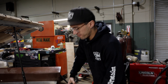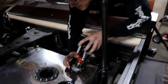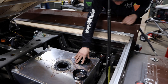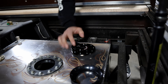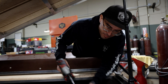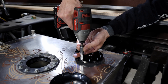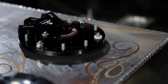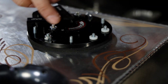Now this is ready to be installed in the tank. The first step is installing our gasket over the studs and then very carefully installing the sender into the tank itself. Line up all the holes, get it sitting flush. To fasten this down in the tank, you go ahead and take these clear washers — usually the studs don't stick out enough off the jump, so what I do is put two nuts on there and make them up just to press this gasket down. Then grab our individual washers and slip them over each side. With those two tightened, it compresses the gasket to allow you to get the washer on there and the nut.